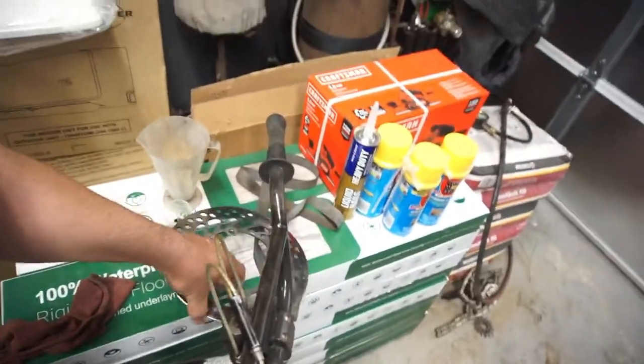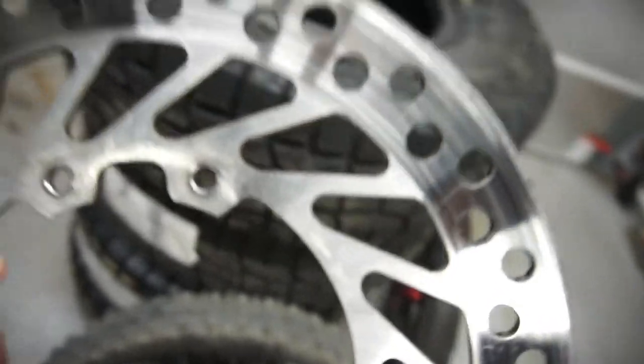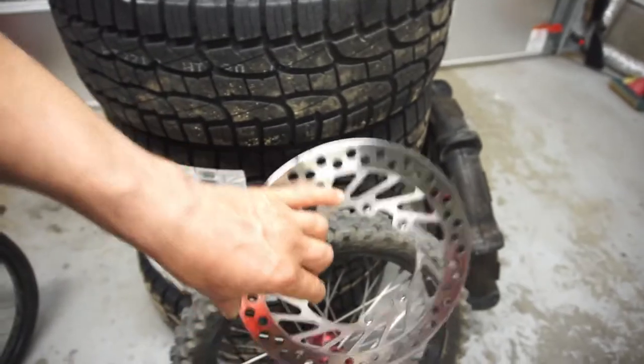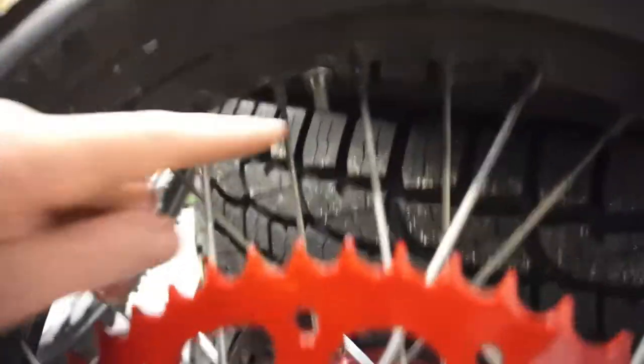Now I just need to stick this rotor on this front wheel. As you can see it says 'drive' — that's the direction. Basically the way Honda does it, all the lettering goes out. So these will be my dune wheels. I did want to show where the rim lock is — there's a flat spot here like someone cranked the wheel lock down way too far, and the rim is cracked right there.